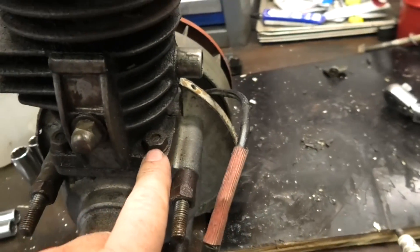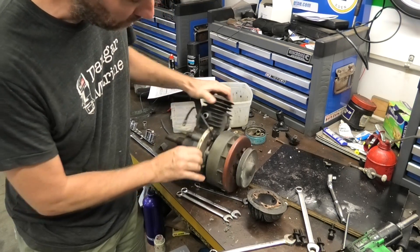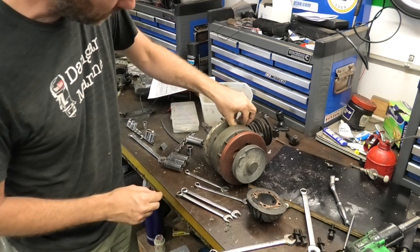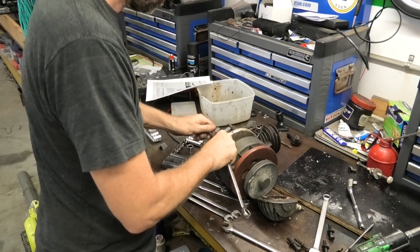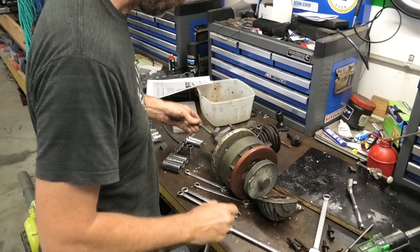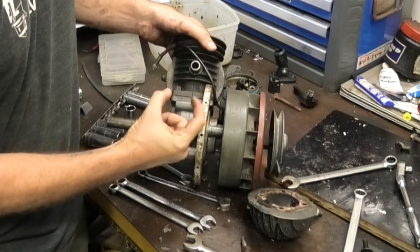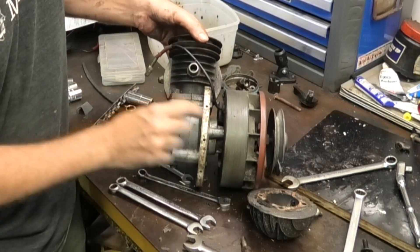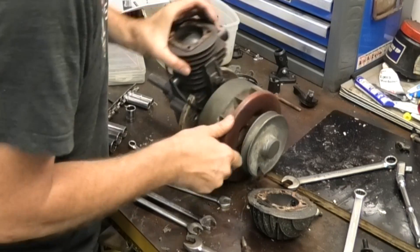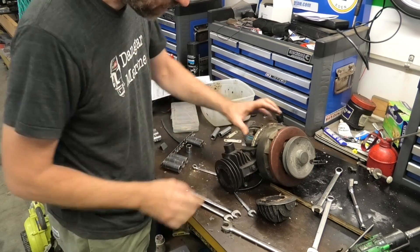Now we've got a couple of bolts here. These nuts are tricky to get to with this little plate in place, so I'm going to see if I can get this plate off first. These bolts that hold this flange on hold the crankcase together, but the bore seems to span both halves as well, so we won't get it apart until we get this off. Looks like we have to lift this plate up, but at least it's given me access to these bolts now.